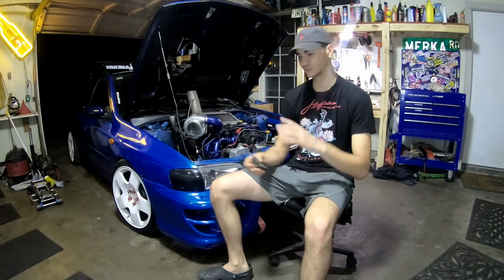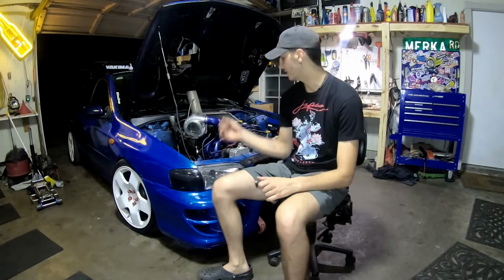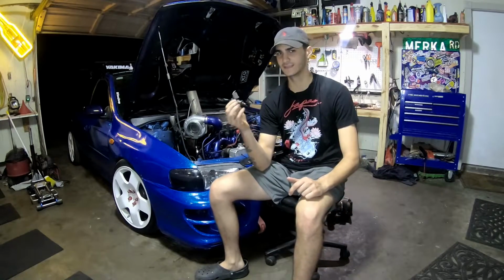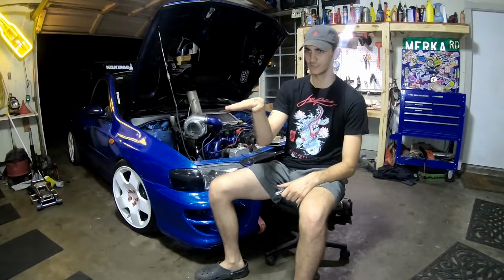Before I tried to get dynoed, probably about 9-10 months ago on that turbo setup with the smaller turbo, at 4,500 RPMs my stock injectors were at 97% duty cycle, and that was at no boost. My tuner was literally doing the cruise map before I even floored it. Never did any power runs, never got any numbers, was literally just barely pressing the gas trying to get the fuel map done for before boost, and these were maxed out.